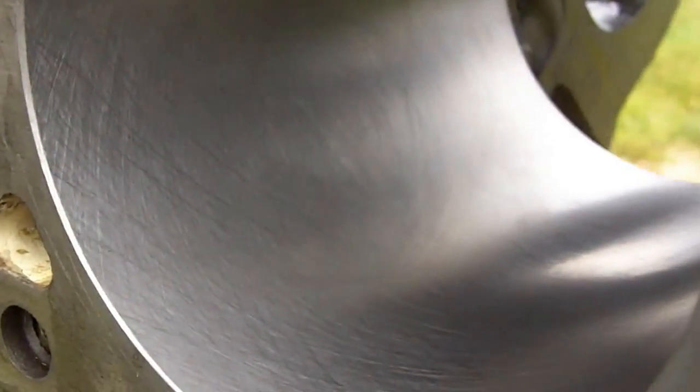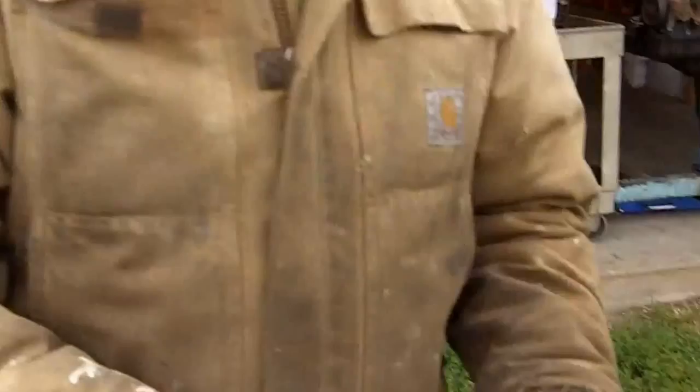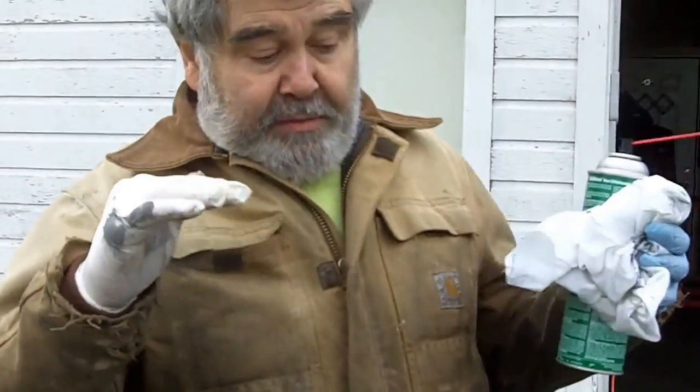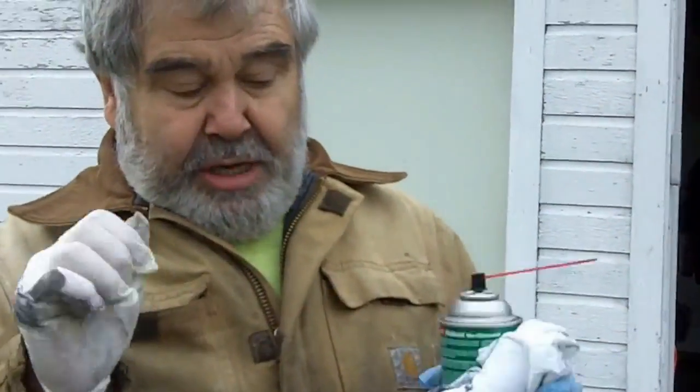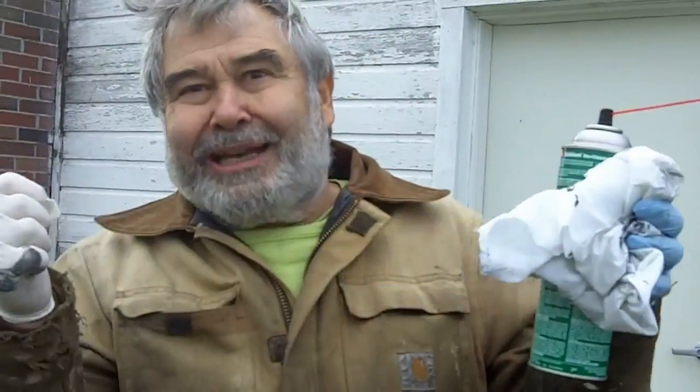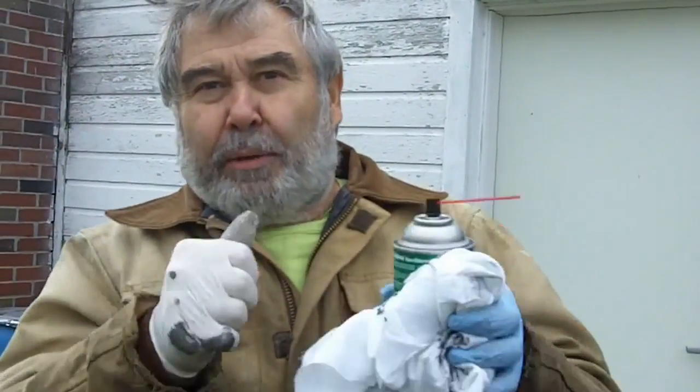So there you can see it — there is a honed cylinder. Now there is not going to be a lot of difference there but it will seal the rings much faster, which is what you want. You want less wear and tear on the piston ring itself. You want it to break in. We described the Chrysler Hemi break-in which is 10 full throttles from 30 to about 90 miles an hour. And what that does is, if you know anything about internal combustion engines, the combustion pressure gets around the side of the ring and pushes it out. So you want maximum combustion pressure to push that ring against the cylinder so that it wears in good.